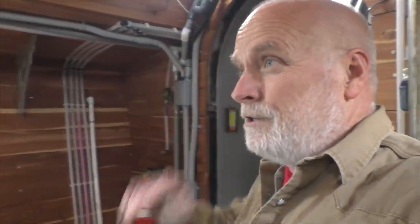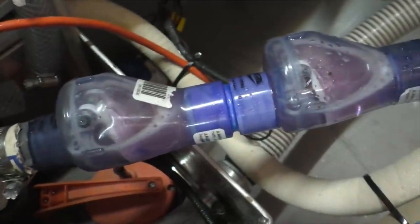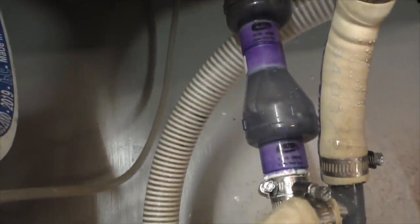The last thing is the rainwater collection system. And that's made out of PVC, so it breaks pretty easy. But we're down in the bow, so that should let everything drain. We'll just take our chances on that. I got antifreeze in the check valves from the bilge pumps, but the one from the rainwater drain system, that I can't do anything about. A little heat tape around it would take care of that. Because we're going to go to the Arctic anyway and need to keep that from freezing. Shackleton would have put heat tape on it.